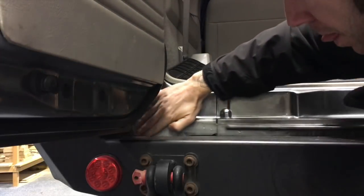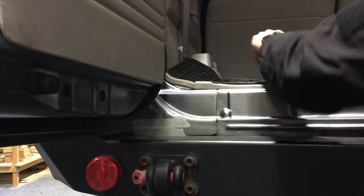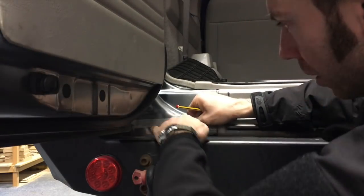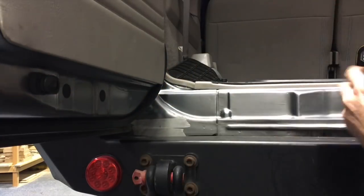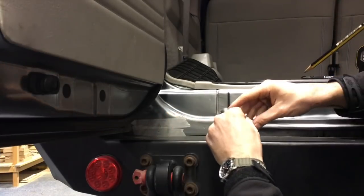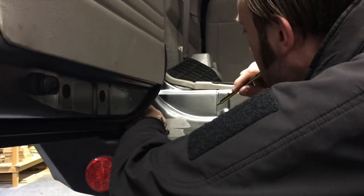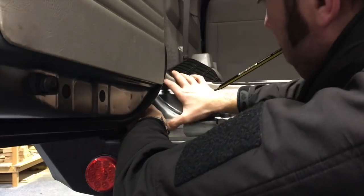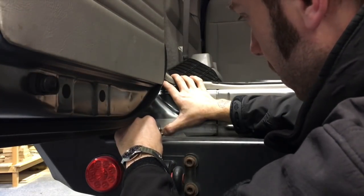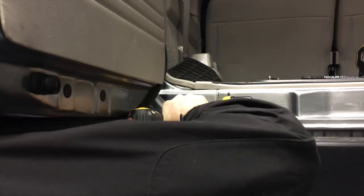The first thing we need to do is mask off and mark for the centre of the bracket. It's difficult to see on this video but you need to mark approximately 65mm from the obvious edge. Next I'm checking for my bracket height — I have mine set approximately 5mm above the bumper, but this will differ depending on what kind of bumper you have. With the holes all marked up it's ready to drill. I went straight in with a 5mm drill bit.